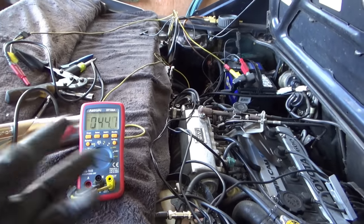Let's take this thing on a test drive and monitor the air fuel system. Four channels: channel one blue trace is on the TPS, channel two red trace is on that vane airflow sensor signal, channel three is the oxygen sensor, channel four is the injector control wire. On the Pico channel we can use the math channel to calculate pulse width. I want to see how this thing runs in closed loop, open loop, across the board while driving. It's a pretty classy setup - we've got that zip tied there, Pico on the headrest, and laptop.